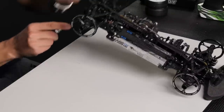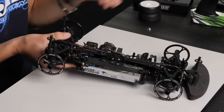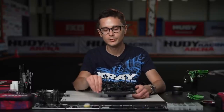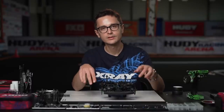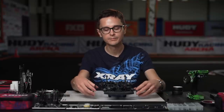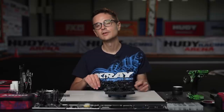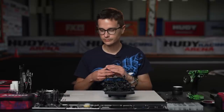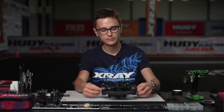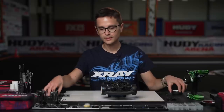You should check the tweak ideally every run. You can double-check this on four-corner scales — put the car on the scales and see how much load you have on each tire. If it tweaks fine with the lifting method, normally it will give you even numbers on the scales. This car is good to go — we can prepare the tires with the additive and hit the track.